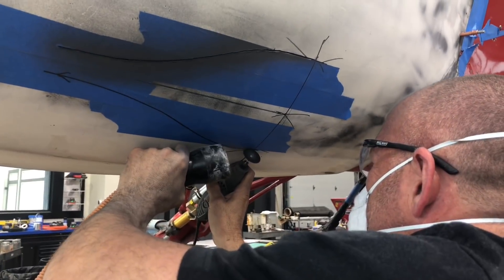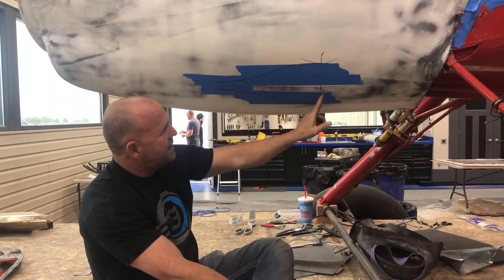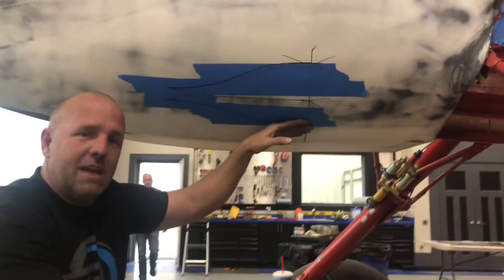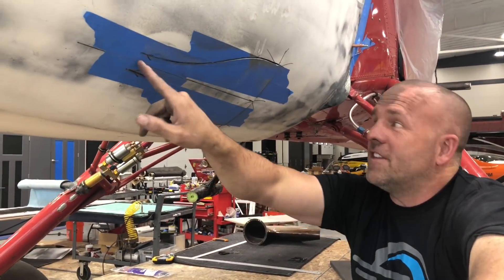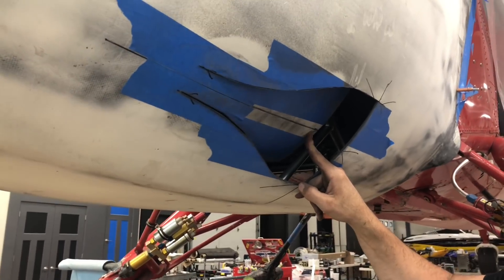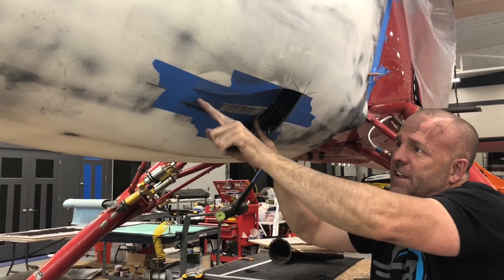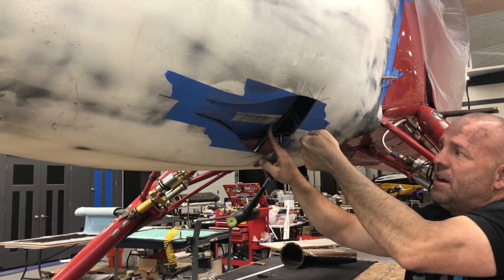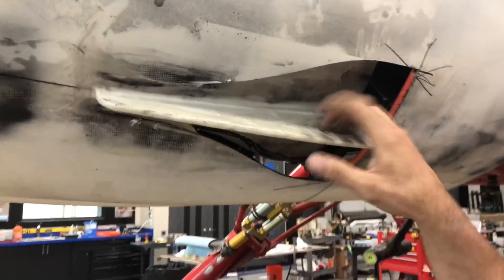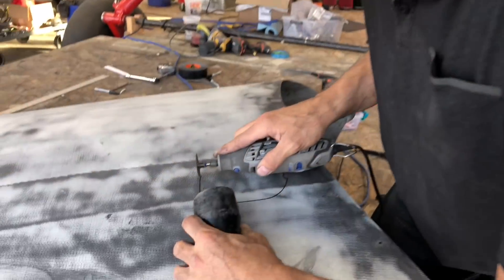The way I'm going to build this NACA - I've done it before and it's so easy. I'm not going to cut this section right here. I'm going to cut down this side and this side, then take this existing carbon fiber - it's already got the rounded shape I want - and push it in on this cutout, leaving this here. I can slide this in and put it however far I want, which on this NACA will be about two and a quarter to two and a half inches back. I'm also going to put a directional fin that stands upright, comes out beyond about a half inch and then blends back forward. I just cut that out, pushed this back, and put in this little fence. This is going to be my new oil access door with a simple push-to-release, hinge forward.